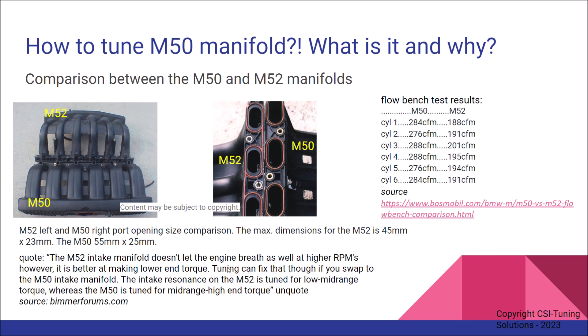So if you want to get the max power out of your M52, this is still, in my opinion, the best bang for the buck — install or swap the old style M50 manifold on your engine. You can get these used still for a reasonable price and you get the most horsepower gain out of it compared to doing other things. Now, I'm not going to go into what you need to change on the engine for the actual installation — it's not one-to-one plug and play, there are some things that need to be adapted, but there are tons of videos online about this.